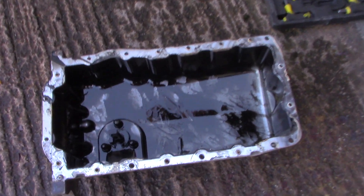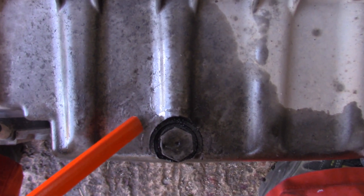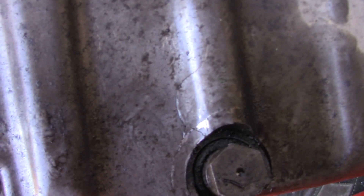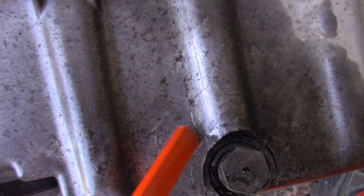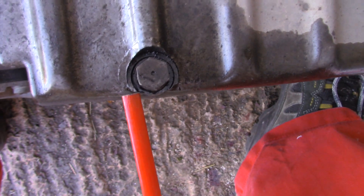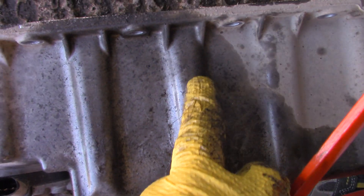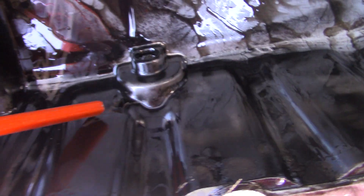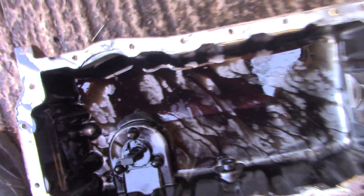I have the sump off — all bolts are out. We'll turn it up on its side to have a look at the damage. It's hard to believe, it's not a lot. I'm trying to get the camera down in there. You can see it's cracked down there — I think it's got a drive from underneath, pushed up and split right up here. You can see a slight cracking along there too. That sump is completely scrap.